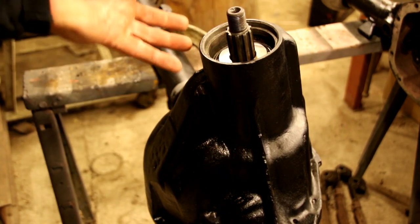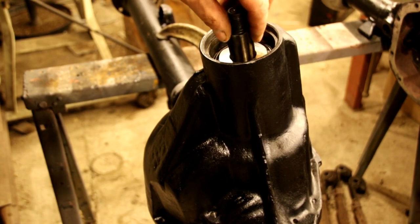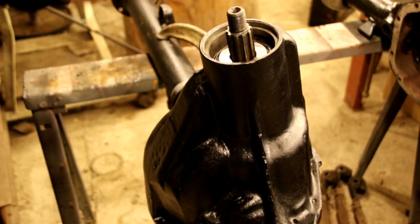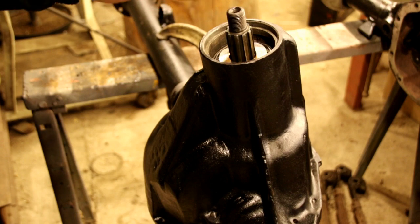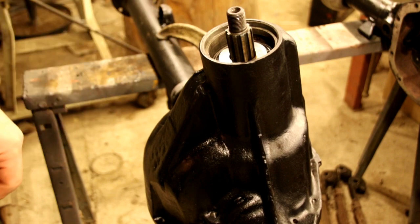Now we're going after the squeeze on the bearings. And we're going to measure the torque on that while we're turning it. So no oil seal, no oil slinger, nothing like that. We're going to send the yoke on there, we're going to tighten it, we're going to lock it down around 100 foot-pounds, and then we'll measure and see where we're at.